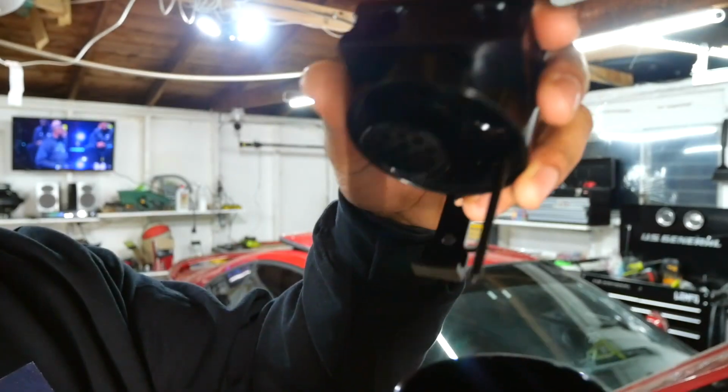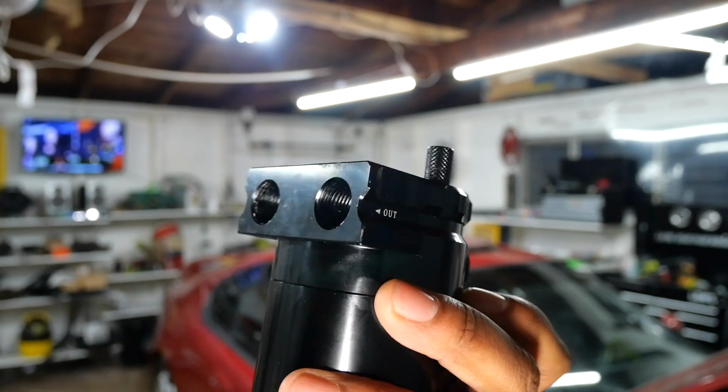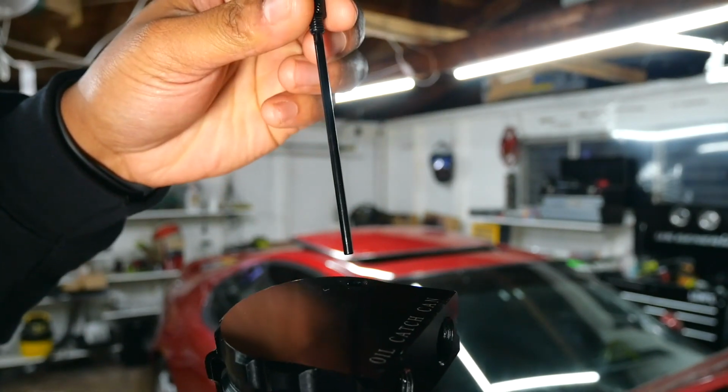I'll leave it in the description below. So with this catch can, you've got the canister at the bottom to collect the oil. And also you've got two ports, one in and one out. That's what connects to your PCV system. And at the top, you've got a dipstick to make sure the canister's not full. That way you don't have to completely take the bottom off.